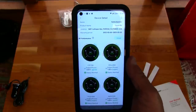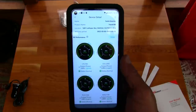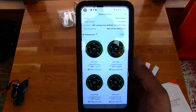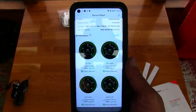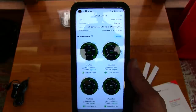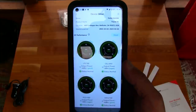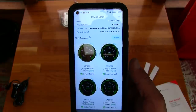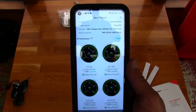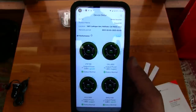Before I go further into the installation, I wanted to share something about this product that makes it truly unique — it has a Bluetooth interface that allows you to link to it with your cell phone. It does require you to register, but with this app it gives you the performance data of what's going on and lets you know if it's been installed correctly based on the signals, and if there's any feedback occurring. The app will show you in dials which part is wrong and what you should change — maybe you need to move the outside antenna further away from the inside antenna. This app really makes this cell phone booster stand out from other boosters I've seen. I just think it's a neat touch and I really like it.